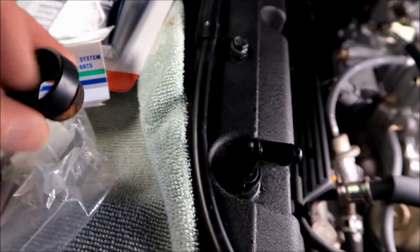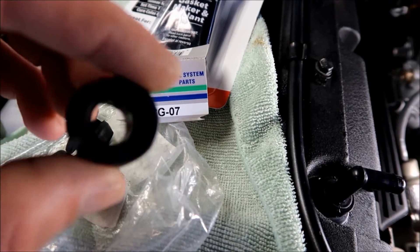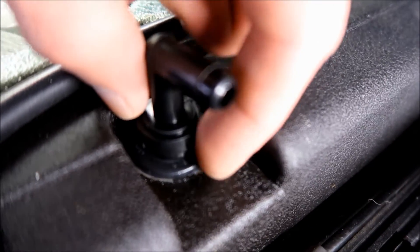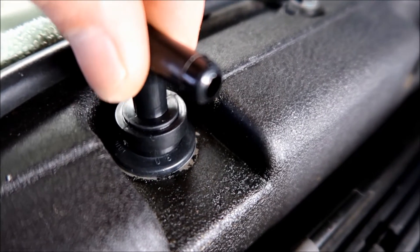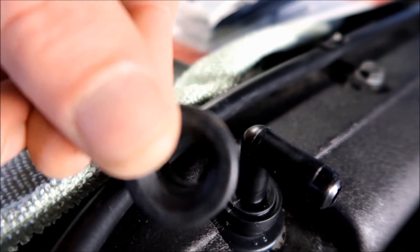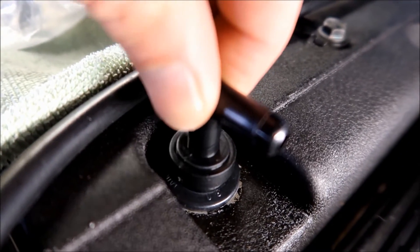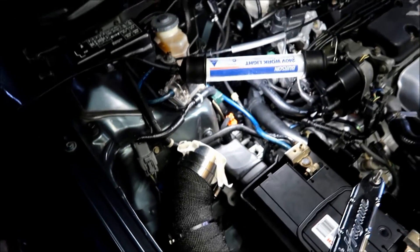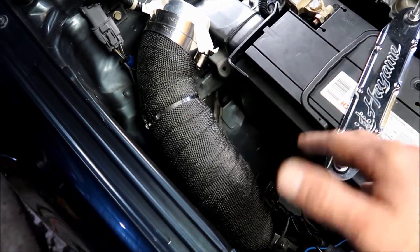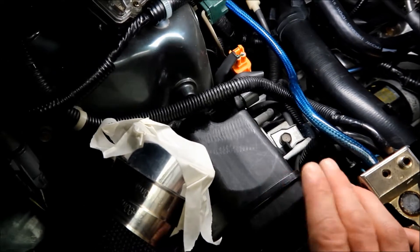You have to take a file to the inside of that grommet — I took a metal file to it to remove a little bit of material, because when you push the PCV valve into the grommet it expands and won't seat all the way flush down to the rocker cover. Take that into consideration — you will have to remove a little bit of material from the inside of the grommet. That's how I achieved this setup and I'm very happy with the result. Also, since I've deleted the stock air intake box, we're going to remove this pollution canister because the vacuum line that goes to the stock air intake box is no longer needed — it'll clean up the engine bay a little bit.